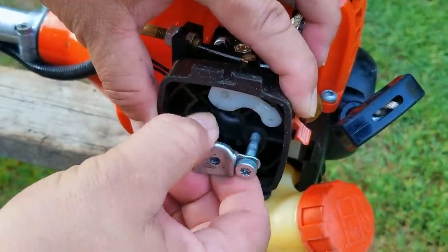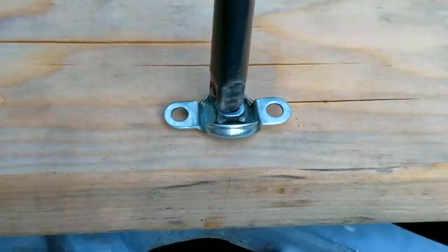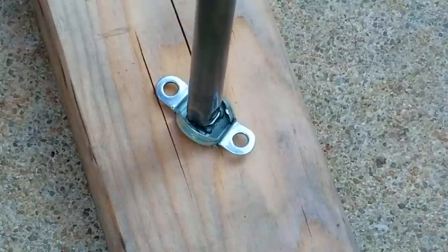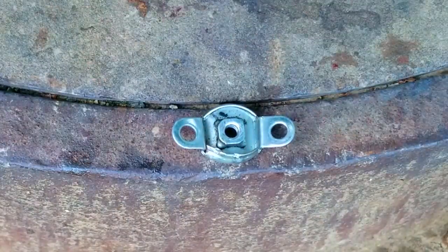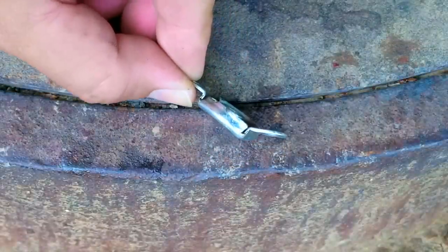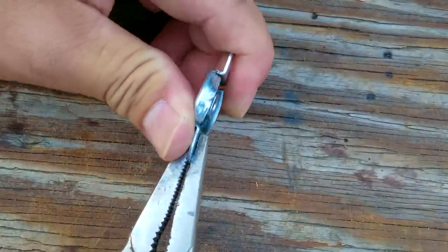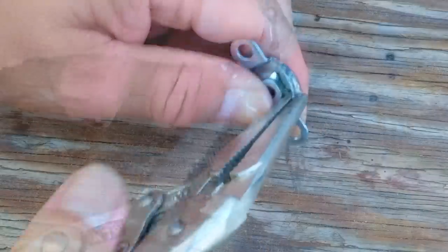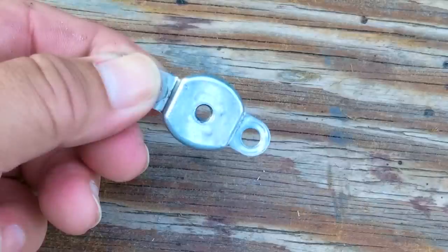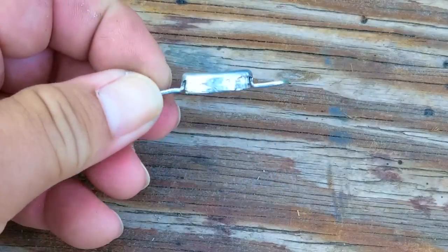What I intend on doing is taking off the plate and then hitting it to try and reshape it. This is a bit easier said than done because this plate is not made out of soft metal. I tried using a piece of wood to avoid damaging it, but it was absorbing too much energy. I tried again on the concrete, but the wood was still the issue. Once I decided to use a massive piece of metal to hit against, the plate gave up pretty easily, but unfortunately it did get bent out of shape. I'm going to pry on it a little bit and bend it back to shape the best I can — it doesn't have to be perfect, just good enough. The front part is the most important part because it needs to be flat. As long as the choke flap can get past it, I think it'll be just fine.